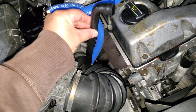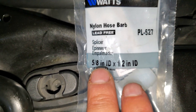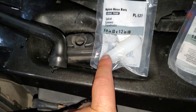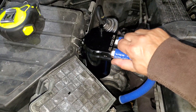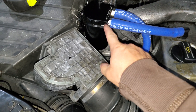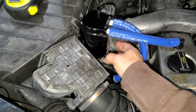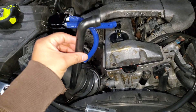This is the original part that goes right in there. I used a piece with a 5/8-inch inner diameter — the bigger one that goes into the air intake boot — and the other is half inch that goes onto your hose. I used no clamps; all these are pretty snug and there's no way you're pulling them out without really trying. This is all vacuum, so there's no pressure, which means you don't need clamps. Make sure everything is tight so it doesn't come loose.